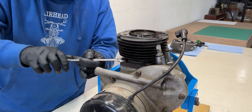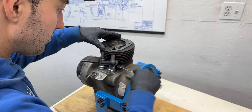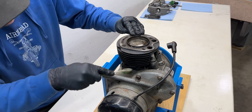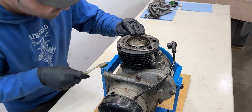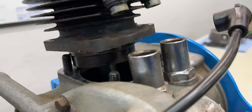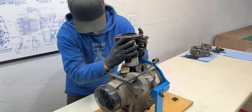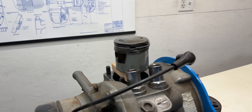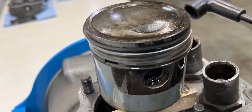To fully reveal the piston I'll remove four nuts securing the base of the cylinder. Before taking it off I'll give it a quick scrub to prevent any dirt or debris falling inside the crankcase. Slowly lifting off the cylinder jug reveals the connecting rod and piston. Placing a wooden block underneath the piston prevents the connecting rod from hitting the engine block. With the cylinder removed we can see the classic Nural brand four-ring piston. Modern pistons typically use a three-ring design which is now more common.